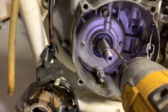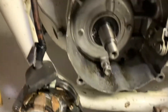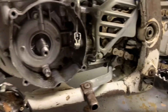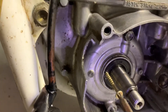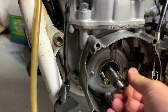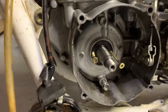I'm going to drill out the crank seal. I'll drill just enough so I can get this screw head through there. There's metal inside the seal, so you want to make sure you don't get too many shavings falling into your bearing on the other side. I'd vacuum this stuff out. I can just get the screw inside — this is only to get a grab on it. These are self-tapping like wood screws. I'm going to go in just enough to where it'll grab good — this is just a way to pull the seal out, kind of like a blind puller.